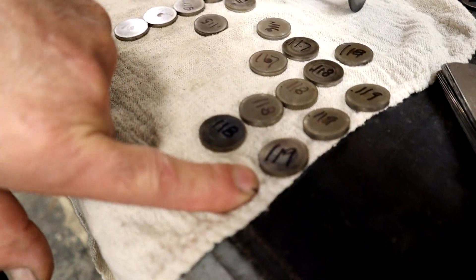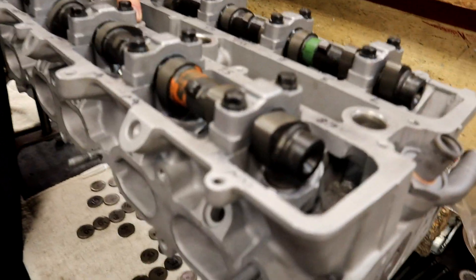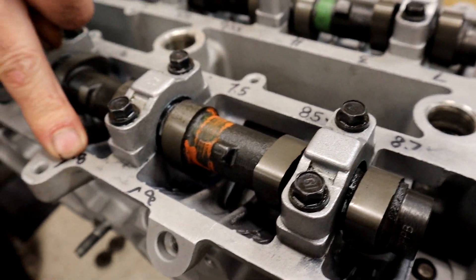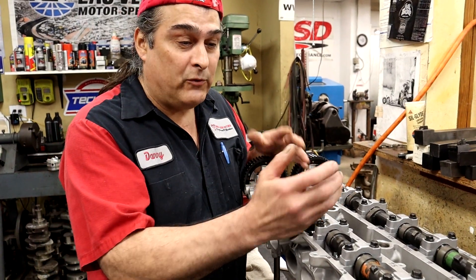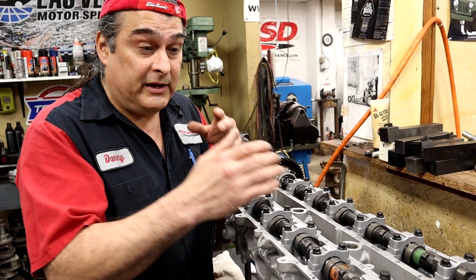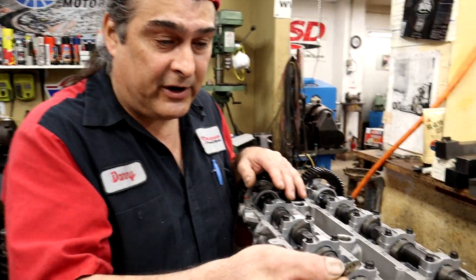Here's what I've done: that's 119, 118, 117, 115, 114 — I'm just laying them out to what we have. Then we look at our adjustment and we know that if we need to change something, it was a 7.5 and it's now an 8. You can tell what they were before and what they are after. When the head first came in, the very first thing we do is check what all the valve adjustment is — we want to see what it came in at, because we're going to keep everything in order. If your head was adjusted right, it saves a lot of time. So when you tear the head apart, you don't want to throw everything into a bucket. Each one of these shims is specific for every valve — a specific thickness.